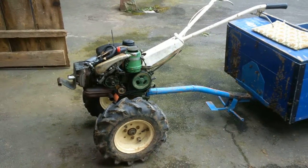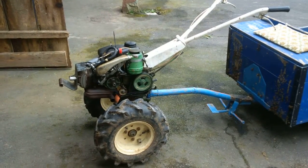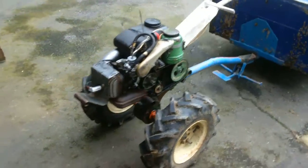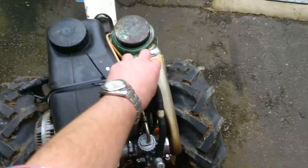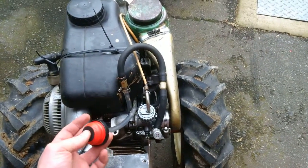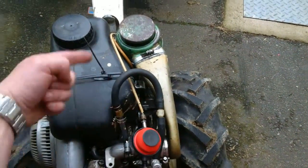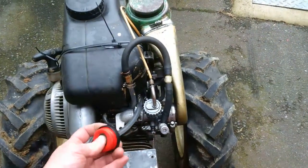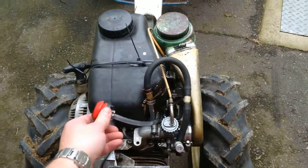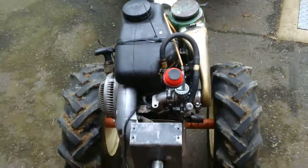Then a friend popped around — he knows about engines, he builds model aircraft. We eventually figured out that there was a short circuit, basically. There's a circuit breaker that you press to stop the engine, and that was basically stopping it from starting. Once that was sorted, that was okay. The only other thing that was a bit crappy was the fuel pump — the fuel line is really weird, because the outlet on the tank is lower than the carburetor, so there's a little pump that when it's running keeps the fuel circulating. Before you start it you have to manually pump it, and the original one was like a sponge — when you pressed it, the fuel was squirting out all over the place. So I got one for a chainsaw, patched a little hole in it, and that works great.